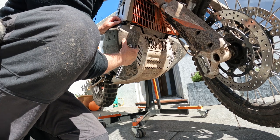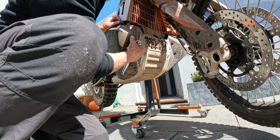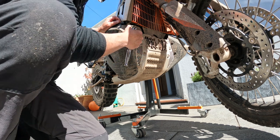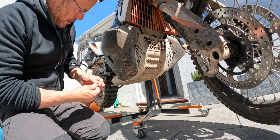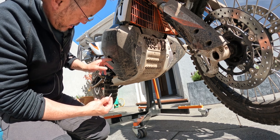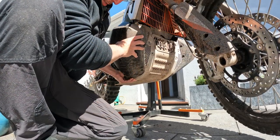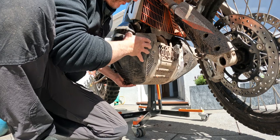These bolts here on the fuel tank cover are really just holding the fuel tank cover onto the bash plate, so we can take the whole thing off in one big piece by not undoing these ones. There are two hex bolts under here for the fuel tank protectors which go onto the bushes that link onto the fuel tank. Once you've undone all the bolts, the whole bash plate and fuel tank protector should come off as one piece.